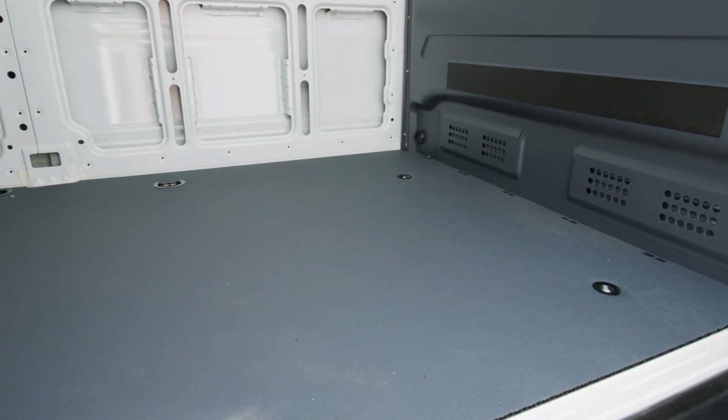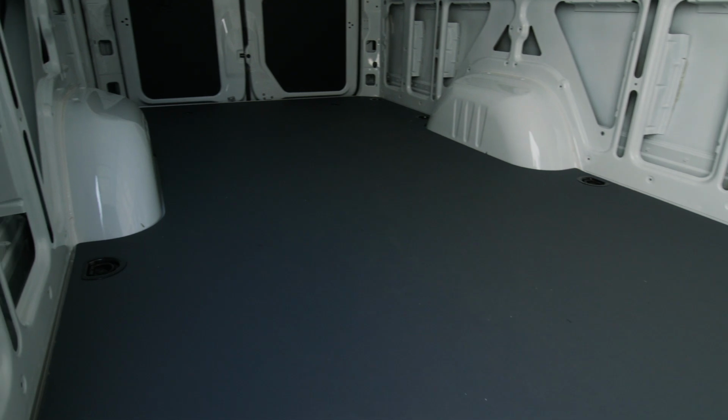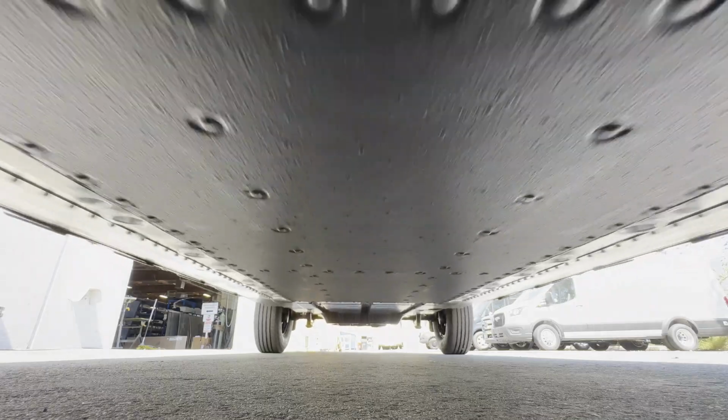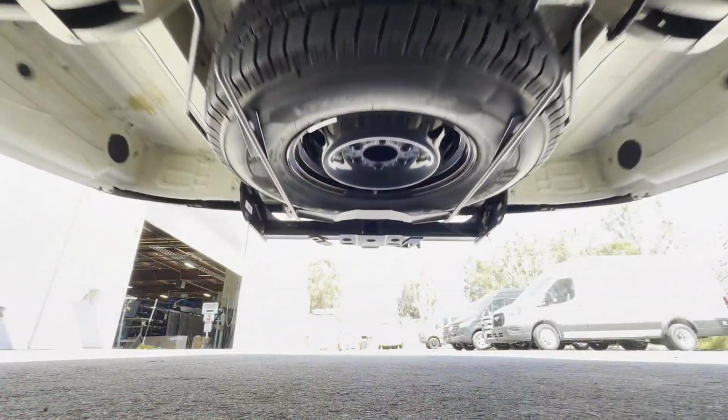Our battery pack starts about at the B pillar and is gonna work all the way back to about the rear axle, and the whole underbody is completely taken up with those battery pack modules. So no drill zones, pretty much the whole center of the van. So that is gonna change what we can put on the floor, where we mount it, and how we mount it.